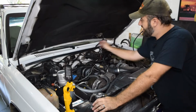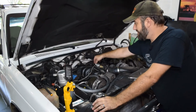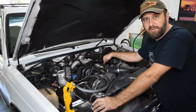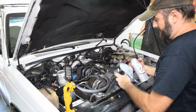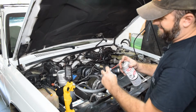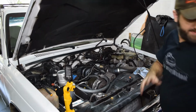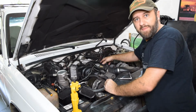Okay. All right, so got the intake tuning valve reinstalled after I cleaned it up. Everything's hooked back up and all good. While I'm in here, I'm also going to pop out the map sensor real quick and just clean that sensor off and then reinstall that as well. And with a small port like that, it's going to spray in my face if I don't cover it. Leave that off for a minute, let that dry. Might as well spray the manifold port out too. While that's off, gently reinstall that. All right, map's back in now too.